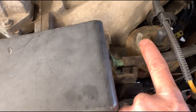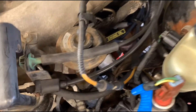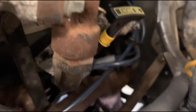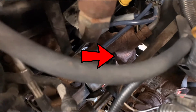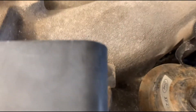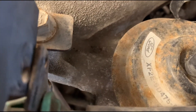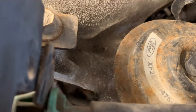This diaphragm and valve assembly right here is my EGR valve — this one is vacuum actuated. If I look down underneath here, this tube coming out of the valve going down connects to my exhaust manifold, which serves as the source of the exhaust gases. The valve mounts right on top with a passageway, and that's the basic layout of this system.